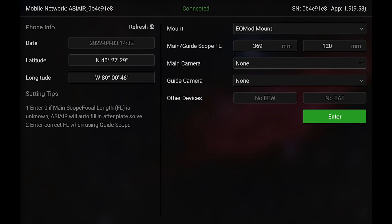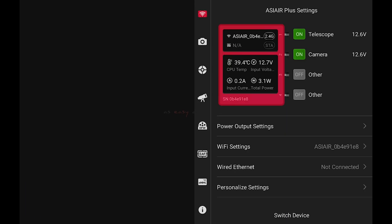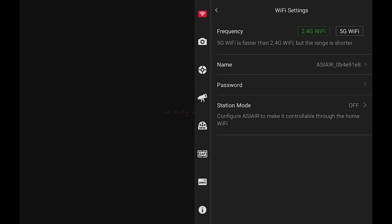Now we are in the app and I'm not too concerned with setting everything else up — nothing is even plugged in — so I'm just going to hit enter. What I really want to do is get it on my Wi-Fi and then get it attached to the repeater I have sitting here, so the next time it's clear I can just take it out, turn it on, and it should be good to go. If you want to go to your home Wi-Fi, tap on the Wi-Fi symbol up top and then go to Wi-Fi settings. When using station mode you have to use the 2.4G network — keep that in mind when setting up your repeater as well; you don't want to use the 5G network.